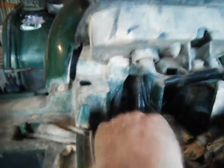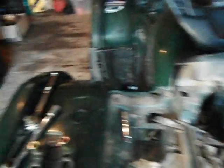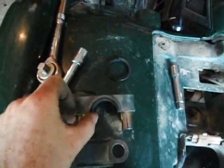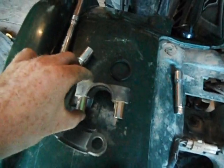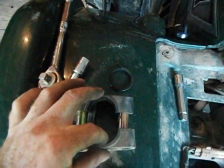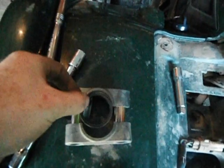You can see I've already removed mine — that's where that shiny spot in the steering stem is. This is what the bushing looks like. This is the back side of the bushing. These collars here are removable; you're going to need to reuse them for the new pieces. Basically all it is, is these two pieces clamped together like that, and there's a seal.